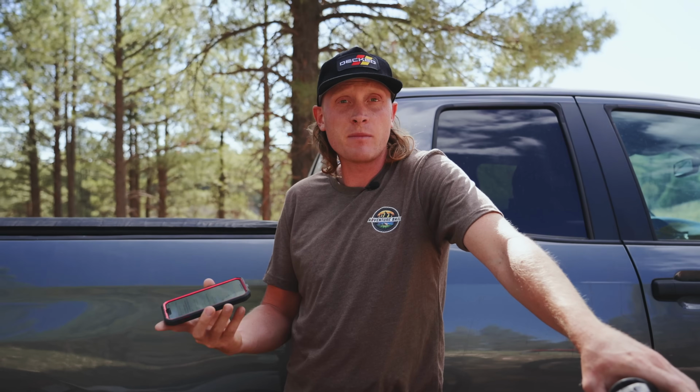The number that I got being a little bit higher than the factory spec recommendation leads me to think that mine has been adjusted. The guy tried to soften it up a little bit, because we have 3 millimeters off. Maybe it's just a coincidence, or maybe the guy actually did mess with it. For my case though, I'm definitely going to have to tighten it up. So that's what we're going to do next, adjust the rider sag.